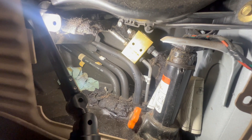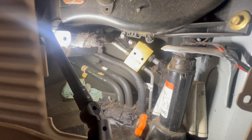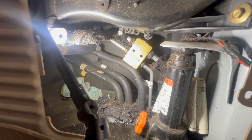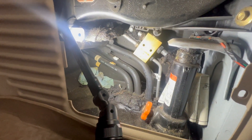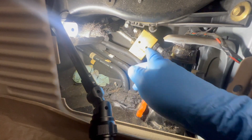So what we're doing is replacing that today. There are no mounts for it — all that holds it up is the hoses going to it. I'm going to show you all how to break this loose, tighten it back up, and then we're going to charge this AC back up and we'll have ice cold AC in the back of this Excursion. We've already discharged the system and reclaimed our freon.